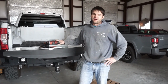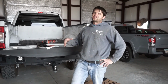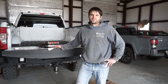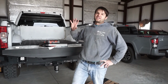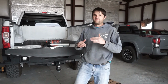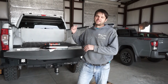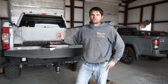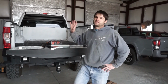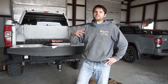I know it's helped out a lot with these shocks for the stuff that we've driven it through, but I was a little disappointed that we weren't closer to 30,000 miles on the rebuild, but it is what it is. Now, our intention was to get them sent back anyways to revalve all 4. We needed to just reduce that valving just a little bit to make the ride slightly more compliant when the truck is empty and we have that adjuster turned all the way down. So this should help us out with that. And I figured since we're sending them in, let's just go ahead and get them rebuilt at the same time and just see how that whole experience is.